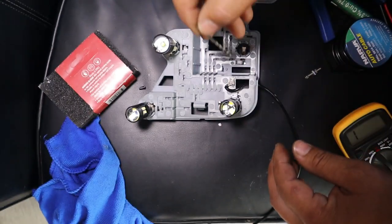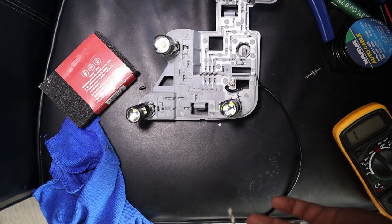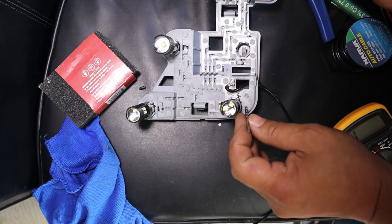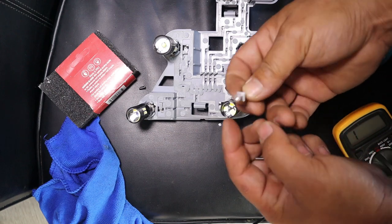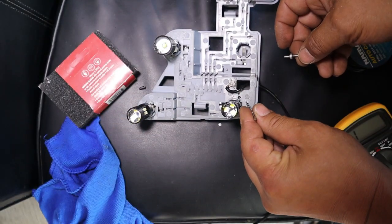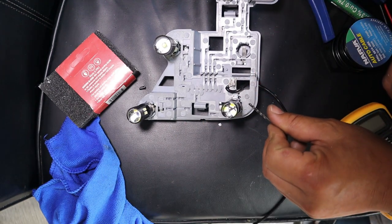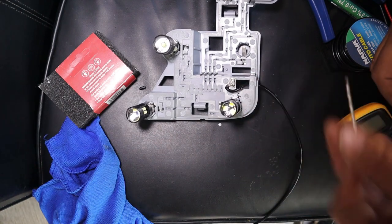And then you would simply get a drill, or if you have a hand drill, you would then simply drill straight through the point. Okay, you can choose any point you wish, as long as there is enough room for your bolt to go through. In this case, I could use here, as I'm using a very thin bolt, and the washer is only very small also. As you can see, the smaller the bolt and the washer, the easier it's going to be to choose a point. In this case, I could use this point here, that point there. These points are going to be the best because they have the most amount of room, and it is close to an open window where you can just feed your cable through.